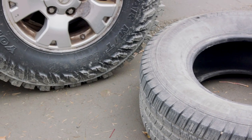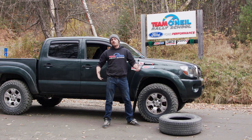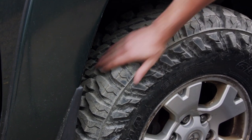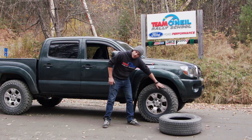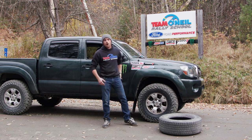So what we've done is fit a set of brand new Yokohama Geolander MTs. We've got whole videos on tires that are good for surfaces like this, but really what you're looking for is a much more open tread pattern, a nice square edge where the tread meets the sidewall, a reinforced sidewall, and thicker plies and just a stiffer sidewall in general.